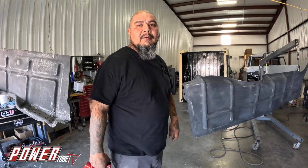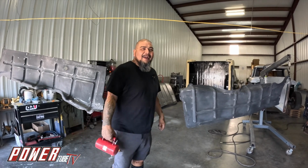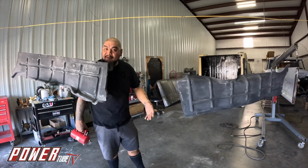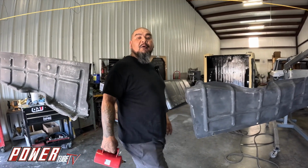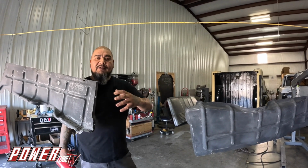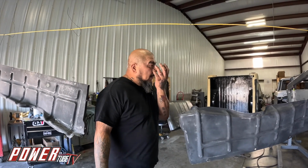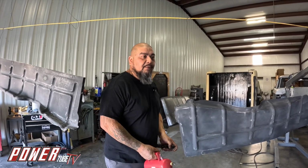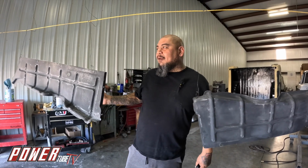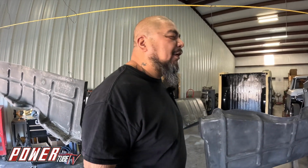So is it like a touch of reducer? Just a splash? Well, I put an extra splash. A heavy splash. If it's 4:1, say 4:1 and 1.5. Maybe 4:1 to 1 is good. I like to thin mine out a little more because I do several coats, and I get it super thick. Every coat is super thick, but I'm heavy-handed by nature. One of my coats is like three of a body and paint guy's coat. I'm not measuring mils here. I'm laying them down.